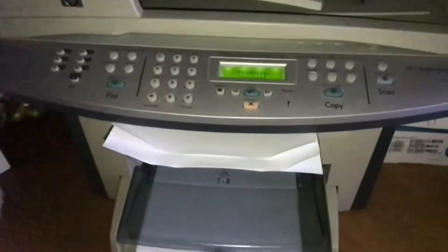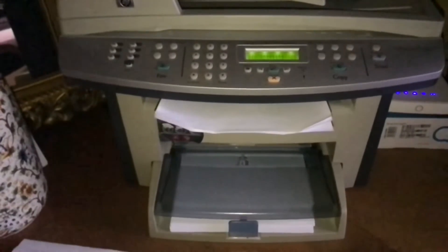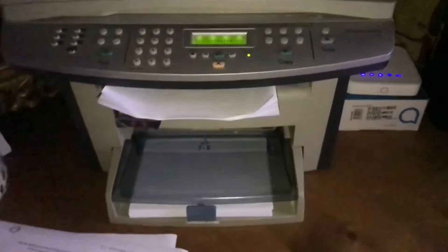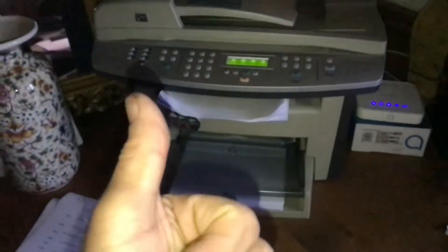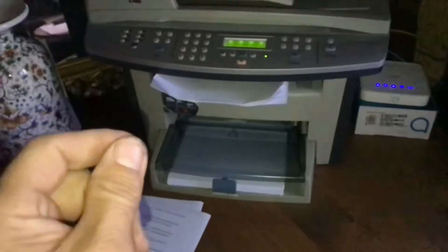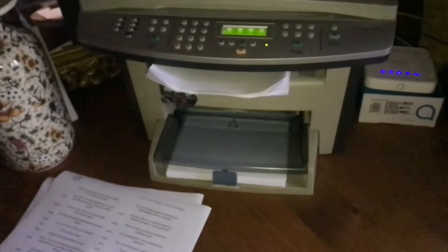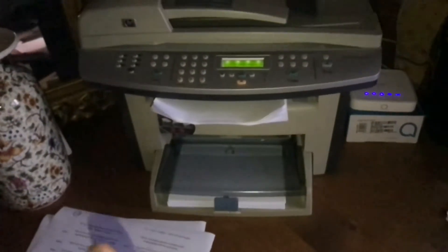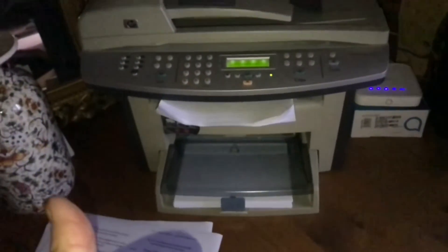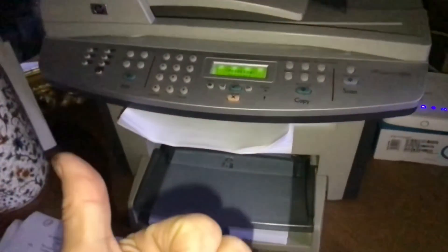Now it's printing — we've done a lot more than it would normally do. That would have jammed up by now. We fixed it! Remember, you can always do it. We fixed the printer — it was that solenoid. You need to take that off, clean the sticky bit off, and put just a bit of tape on there, and you're done. We were going to throw that out, but look — it's got years left in it. Hope this video has helped — you've got another ten years out of your printer because it's a really good printer. Thanks for watching.